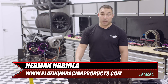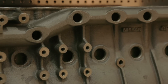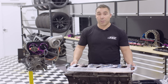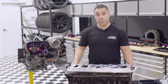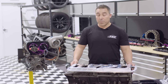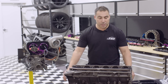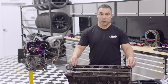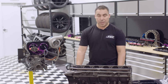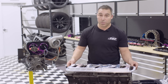The very first RB30 I was asked to build was a rebuild job, and I was given this engine that had been running for years. It was fine, and it had this four-wheel drive adapter, and it was hideous. I just didn't want to put it on the engine, so I thought I've got to be able to come up with something better. I spoke to my client at the time and he said, "That's all you can get," and I thought, "Well, I think we can do better." We can incorporate the original main cap brace here, and there's got to be a way to tie in the pan rails to the original OEM main cap brace. So I prototyped a couple of braces — made one out of steel by hand, TIG welded it all up, and it looked like a very primitive version of this.